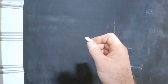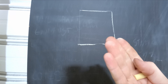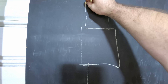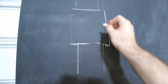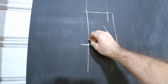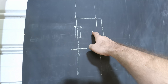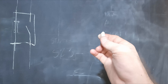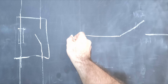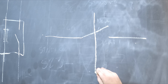A relay is a box. Inside the relay you have four connections. There's a switch inside the relay — there's a little coil and an electromagnet, and what it does is pull this gate open and closed. Think of it like a bridge: say we wanted to move from here to here, we need the bridge to close. Universal relay wiring is done under four numbers. Supply power is usually going to be 30. Power out of the relay is usually 87 to your device. So we go from 30 to 87.